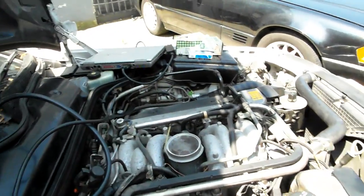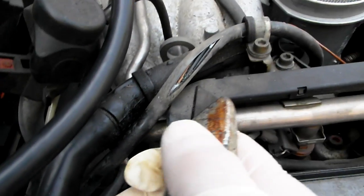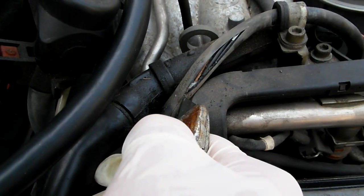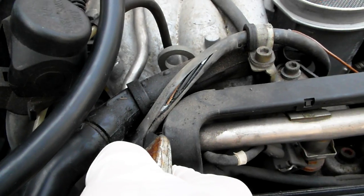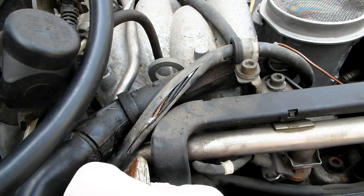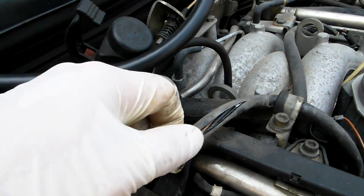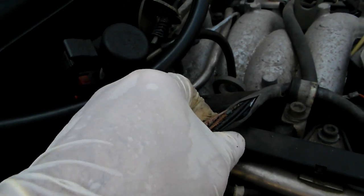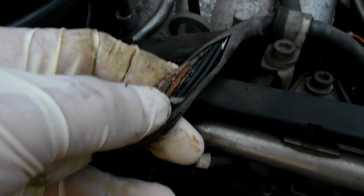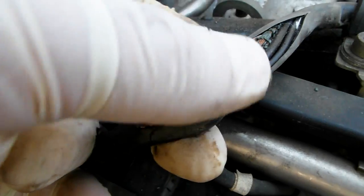I can't find my blade right now, but I already made an incision here. This is the throttle body cable — it goes down to the throttle body underneath. I made this incision already; basically you just take a sharp blade and cut only the upper layer, not all the way through. I already cut it last night — it was too dark to make a video. So you pick up the wire and spread it open, and what we find here is all of these wires basically falling apart.